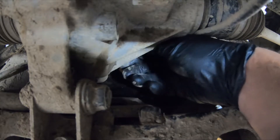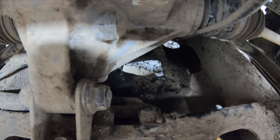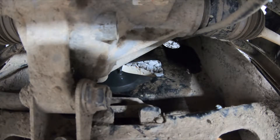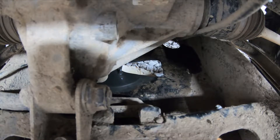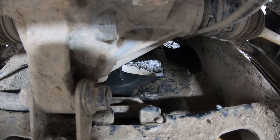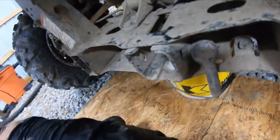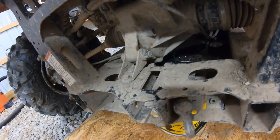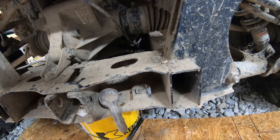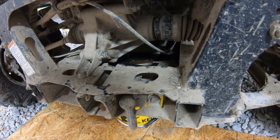I've run the side-by-side previous to doing this and there she goes. Looks pretty good — it doesn't look real dirty at all in my opinion. We're going to let that drain. It is going all over the belly pan of the machine, but we'll keep both bolts where we won't lose them. It's draining down in there. Let's let it drain out and we'll put some 80/90 weight shaft drive oil back in it.